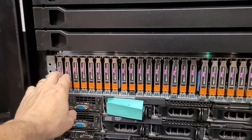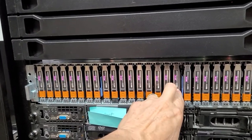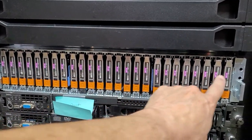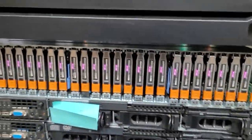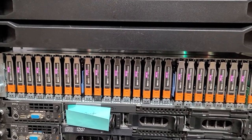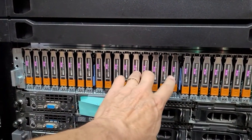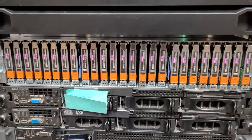Now we're at a point where we can begin testing. We've got the 13-drive set, the two-terabyte drive as a separator, two one-terabyte SSDs, a single 512GB SSD, and then all spinning disks on the other side — those are disconnected, just filling the bay space. You do want to fully populate the bay so that airflow correctly drives heat through. Airflow is what keeps things regulated, and the worst enemy to SSDs is heat. That's why you want a small HVAC to keep you around 69-70 degrees.